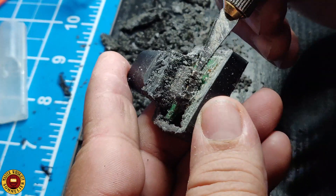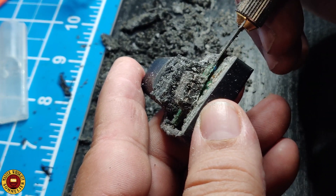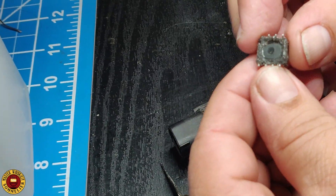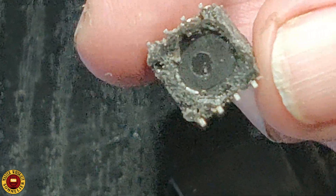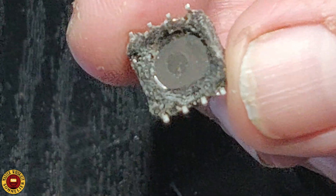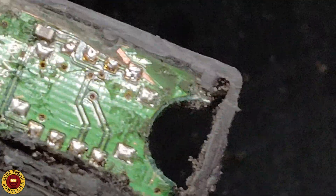Spend a lot of time cleaning, and check this out — you can see it's only being held with two tabs. Not good. So I removed it. You're going to need a solder gun with a fine tip. Look at all that silicone underneath the chip — you're going to have to clean all of this out before you try to solder it back on the board.